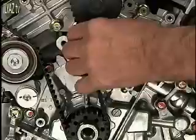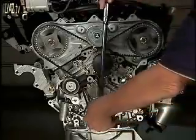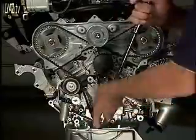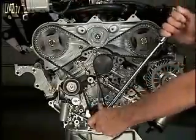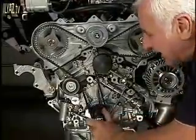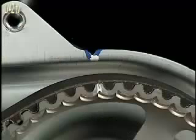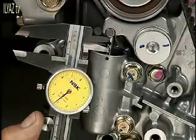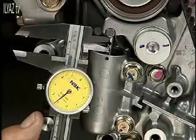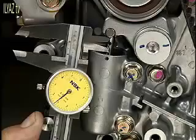Test the belt to make sure there is sufficient tension. Don't forget this important step: rotate the crankshaft two complete revolutions in the clockwise direction, then let it sit for about five minutes, and then recheck the timing marks. Letting the engine sit for five minutes gives enough time to see if the tensioner has provided enough tension to prevent the belt from slipping a tooth. Measure the protrusion of the plunger — it should be within specs. Look up the specs in the service manual to determine if the plunger has stayed within tolerance.